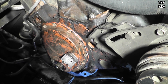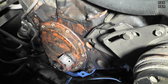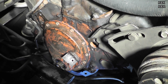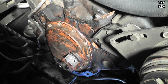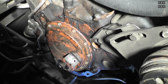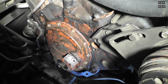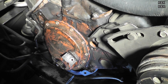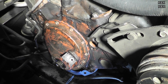We're going to let this sit for 24 hours, or at least 12. Tomorrow morning we're going to come out and torque this to about 8 pounds. With the RTV, you don't want to squish it out. What I've been doing lately is leaving it where it pushes a little out, then I come back an hour later if it's warm, or 12 to 24 hours if it's cold, and do the final torque. Most of the time I actually have really good results — I don't have comebacks or leaks. We have repeat business but we don't have comebacks due to warranty work. That's bad.